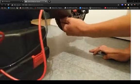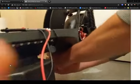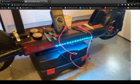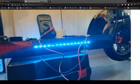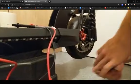I've got this one out before already. The only difference is if you haven't had yours out, then it's covered in a black sort of electrical tape. If you're lucky. But yeah, that's the only difference. And I've soldered mine so the lights stay one colour. Just to show you the lights so far. Just the blue. No flashing or nothing. I'm going to try and do this without adding any parts, without having to buy anything extra. At least you can get a set colour. You can do it a simple way, just by cutting two wires, if you just wanted red, green, or blue.